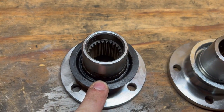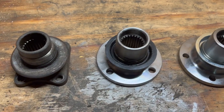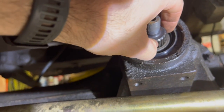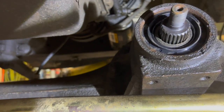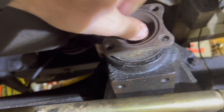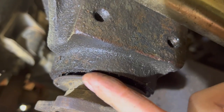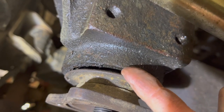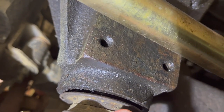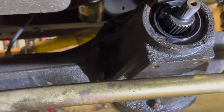Under the truck now. I'm just going to throw the spacer ring on there for the original pinion flange and then put the flange on. And if you can see, there's just ever so slightly a gap between the housing and this mud shield. So that works — no rubbing, there's clearance. That was the original diff flange.